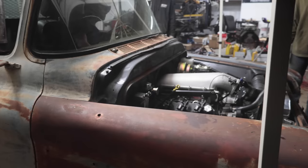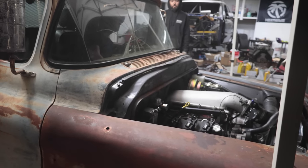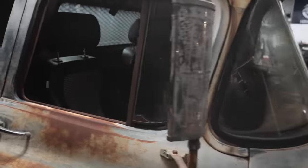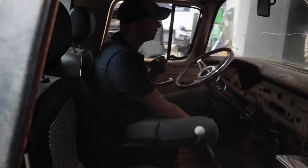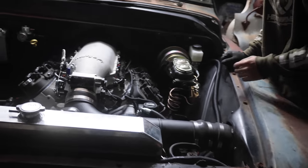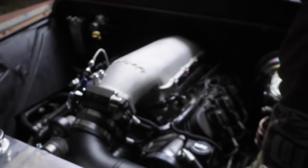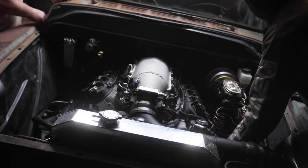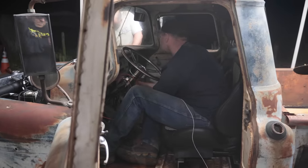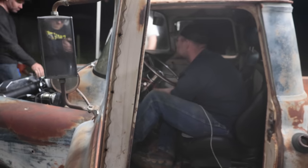Going up to 15, 16 volts. That's pretty high. Yeah. What's going on? I don't know. Unplug that alternator, and then we'll do it again. It's just, the pulley's warm. The alternator's hot. See what it's like, unplug. Try to keep it alive and move it. Everybody just back up, though.